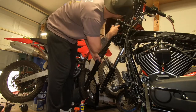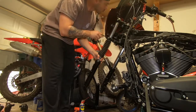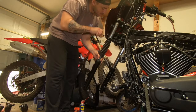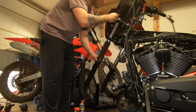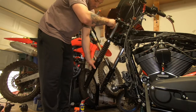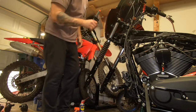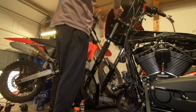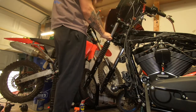This is the second or third time I put this shock in and had to take it back off. You just got to make sure that you have good, straight tubes. The reason I had to take it back off several times is because it was such a hard, tight fit that I did have some pipe wrench marks on there — I had to file them down and get it straight. It's nice and smooth now, but you don't want to take any off the metal because then it's not going to be OEM spec — it could slide. So you only want to take off what you have to get it on.